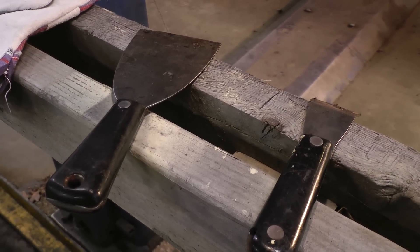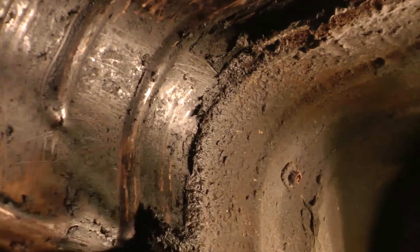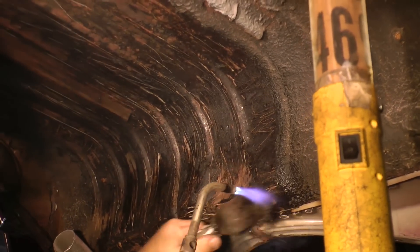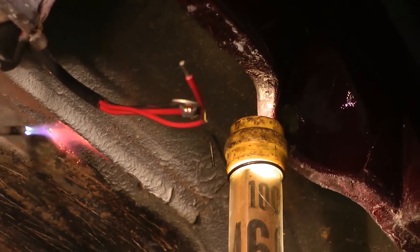The reason why we like to scrape it off is because you don't know what's lurking underneath. There could be rot or rust and cancer spots that you want to repair. Usually what we do is scrape this stuff off and then media blast the rest off to make it nice and smooth, and then paint it the color of the car or put some POR rust-preventative paint to stop it from rusting.